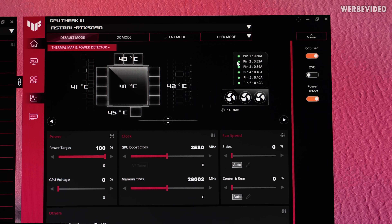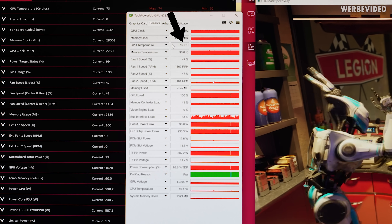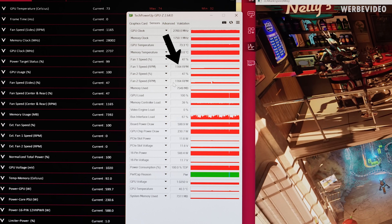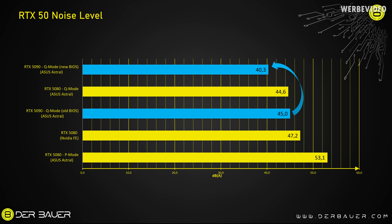I also noticed a difference even at idle, though the difference is smaller there. The temperature is again stable — about 73°C on the GPU, which is about 5 degrees Celsius warmer, and about 4 degrees warmer on the memory. The main change is about 200 RPM lower fan speed on both fan 1 and fan 2. I'm not fully happy with how this is executed because the fans are just running synchronized at a lower speed while the rear fan is still the bigger problem. But it's already a lot better — it dropped from 45 decibels to 40.3 decibels.